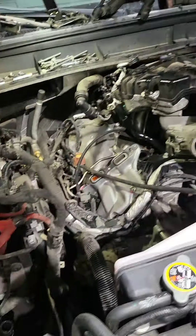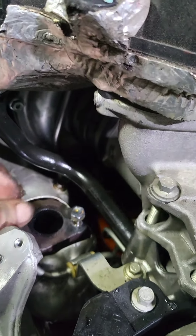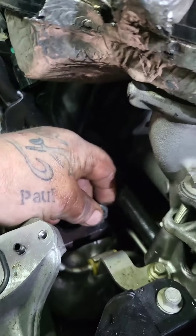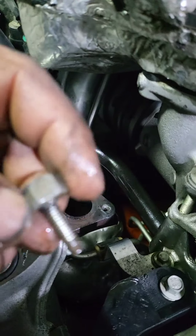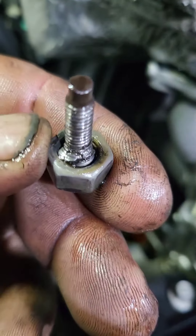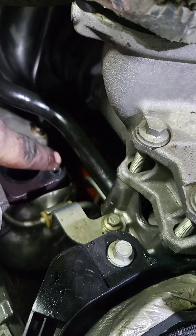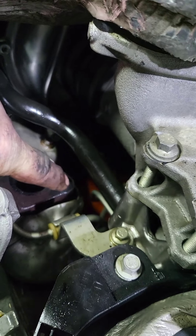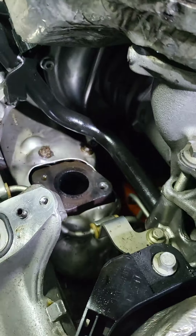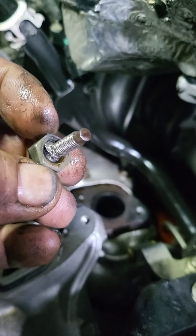I'm back. This second one took a little bit longer to get out, but nonetheless I got it, and I didn't mess up either of the holes. This one I had to weld a few different nuts on it to get it out, but I got it without hurting the threads. This one was broke off down in a little bit. I always weld like a little nut, because if the weld touches the edge of the manifold right here a little bit and your weld ain't just clean on the bolt, it'll be harder — it'll be kind of grinding on this when you're trying to take it out. But either way, I got it out and the threads are nice and clean and perfect.